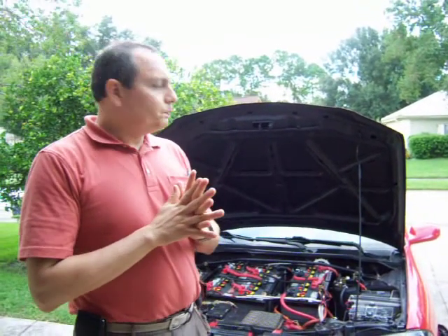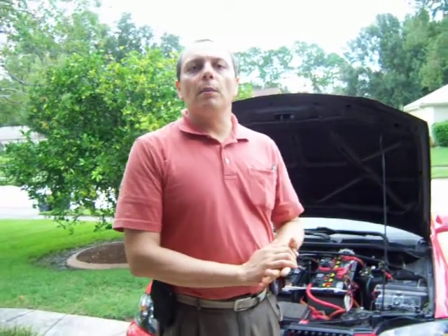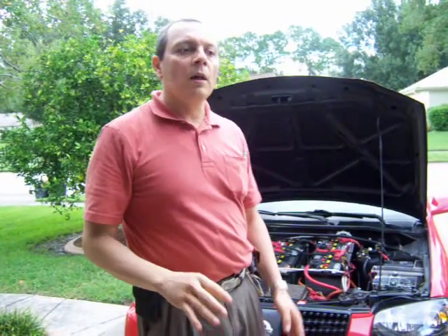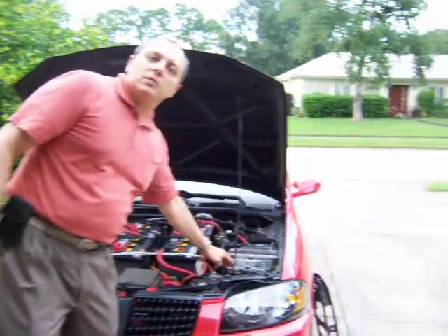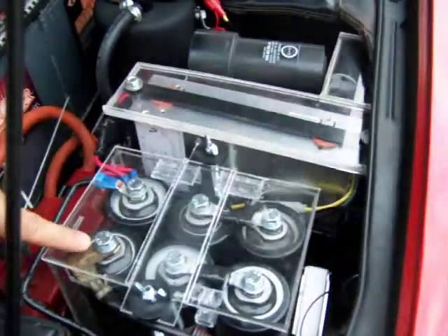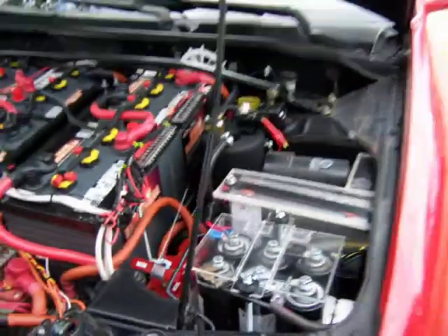Here's a very interesting idea to think about. I've heard about three persons so far that have been trying to put enough of these capacitors in series. These are in series, by the way — 2.5 volts each one — so I get 15 volts, a 15-volt system. But you can connect them in parallel or in series or however you want, pretty much like batteries, and increase the amperage or increase the voltage depending on how you connect them.